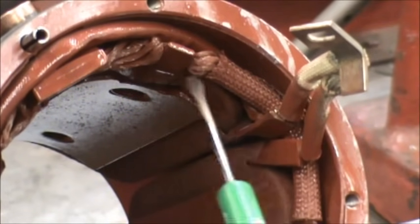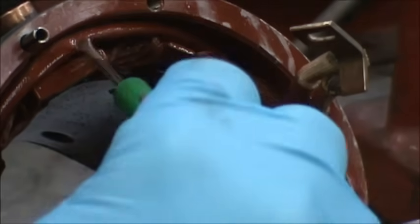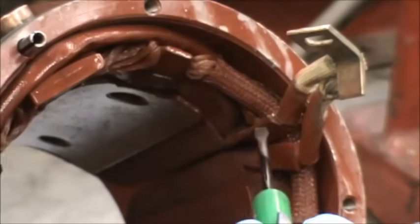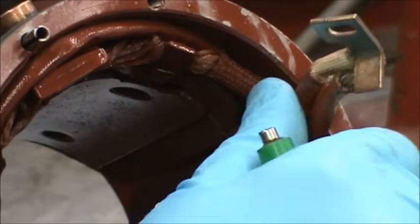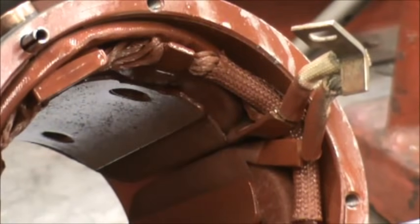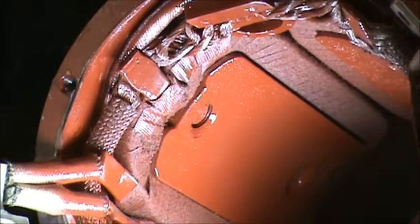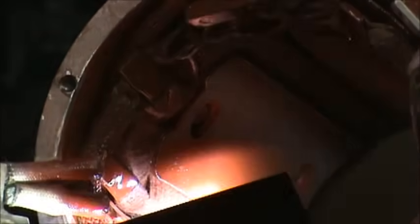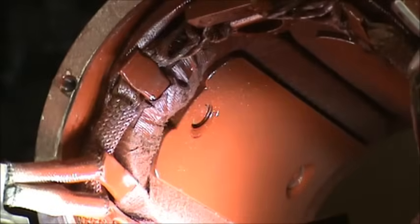We're going to do a visual inspection of the inside wiring of the housing. Make sure the jumper wire is tucked behind the insulator in this area and that the leads coming up on both sides are pushed back away so they can't rub onto the armature. Look down through with your flashlight so that you can check both sides 180 degrees apart, looking for any interference or intrusion that could possibly rub on the armature.